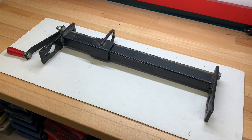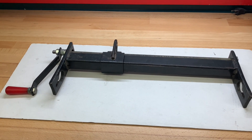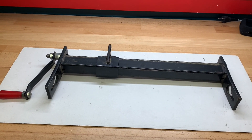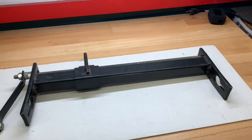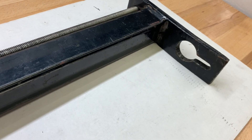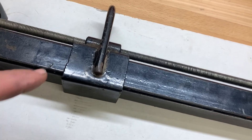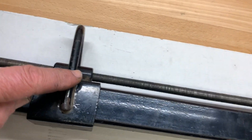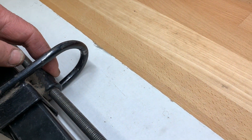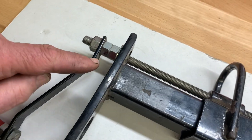This is what I used for about 10 years. It's the very common beam type. You can buy this particular one at Harbor Freight for about $45 and it's pretty simple. It's got a main beam, holes and slots in the end for chains to attach to the engine, a carriage in the middle with a 5/16 steel loop, a round nut, a lead screw, a crank, and a couple of nuts.